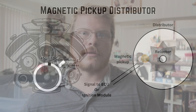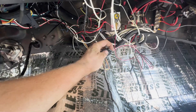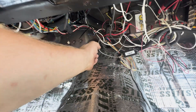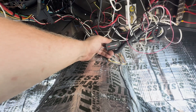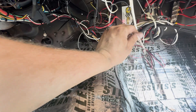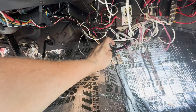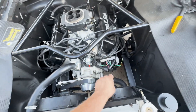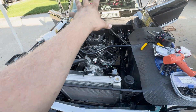Check this out — the Sniper coil driver is mounted right here. This thing gets a ground, the points output from the Sniper — that's what the Sniper uses to tell this driver when to fire the coil — and a switched 12 volt. This gray lead goes to the negative terminal of the coil. The way it works is it's like a really fast-acting relay that can handle more current than the Sniper's PCB circuit can handle. The ECU uses the white wire to trigger this device, which tells it when the coil needs to fire, giving the correct advance. The pink wire provides positive, ground provides a ground for it to operate, and the output wire goes to the coil. This gray cable from inside the car triggers the coil.